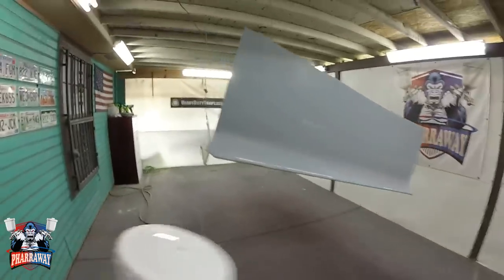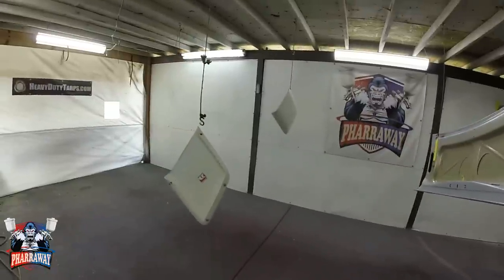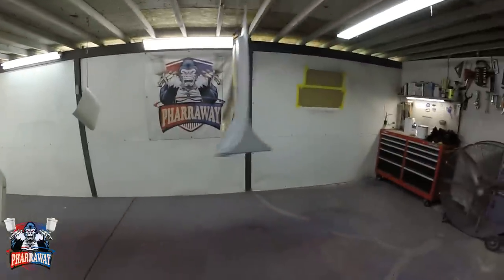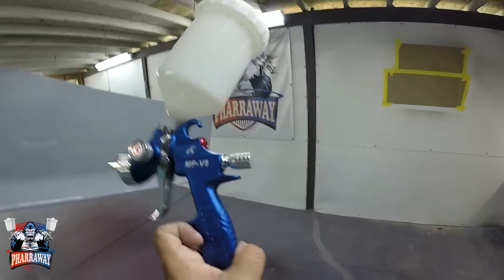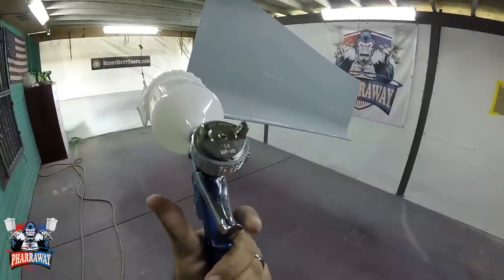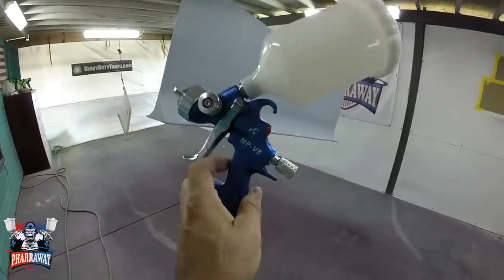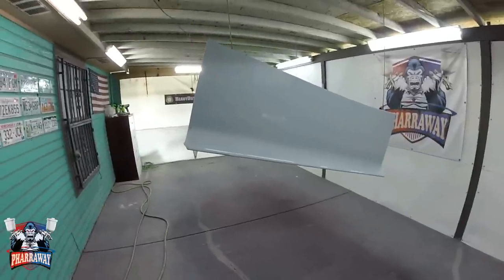In this video I'm going to be painting the trunk lid and some side scoops that go in the car on that Mustang. And the gun I'm going to be using is my FUJI spray, it's the MPV8 with a 1.3 tip. That's the one I'm going to be using for clear also. So let's just get started.